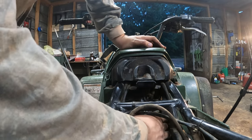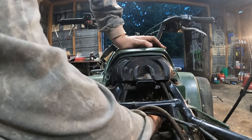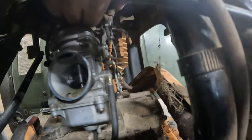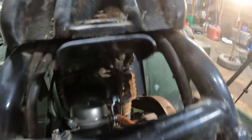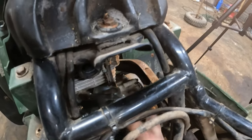On this side you can either loosen the two 10-millimeter nuts — that's what I'm going to do because they're already loose. Pull the throttle cable, loosen it up at the top nut. You should be able to just hinge that out. You might have to unscrew that bottom nut if it's easier for you. Lift the cable up, that comes out, then you can take the carburetor out this side, or just turn the thing sideways.